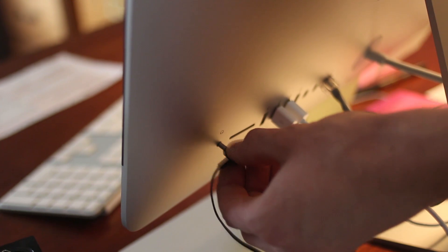Hey everybody, Joe LibTalk, Audio Engineer. Today I'm going to be teaching you guys how to plug in external speakers into an iMac computer. iMacs have an 1/8 inch or 3.5 millimeter stereo audio jack, and this is where you plug in external speakers into the iMac. So this means that your external speakers must have an 1/8 inch 3.5 millimeter stereo audio plug.